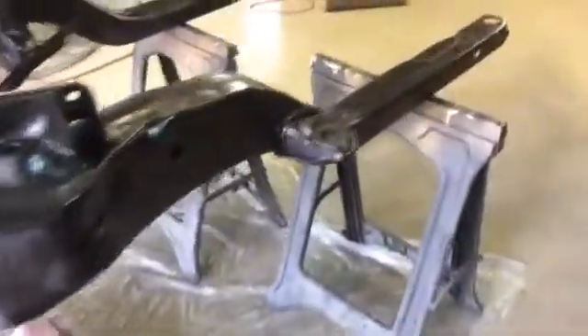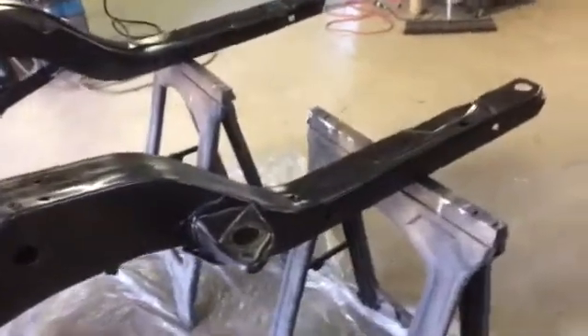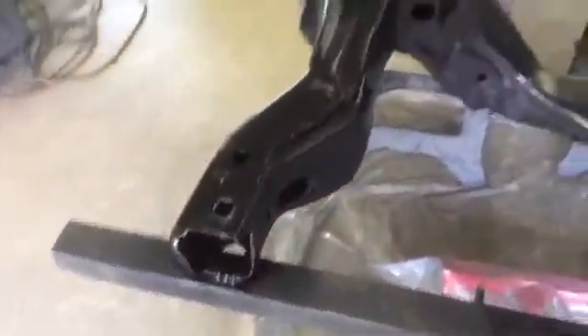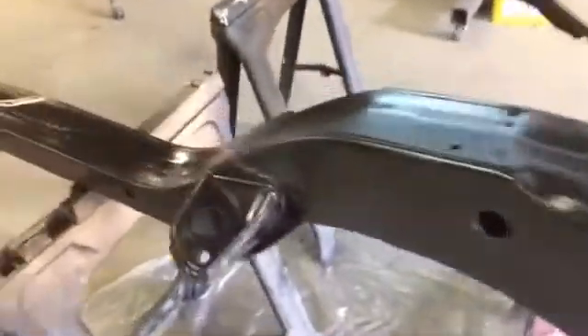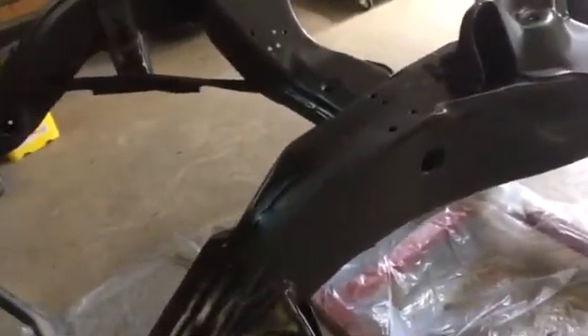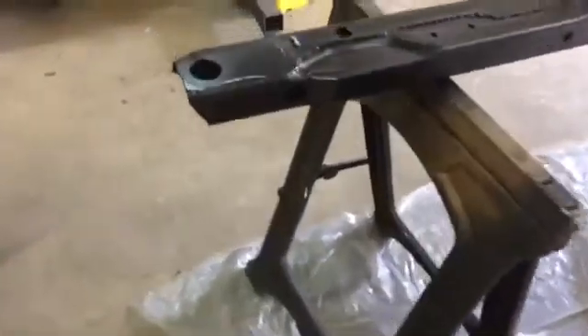It is Friday morning — actually about lunchtime now. We've been on this thing since about 8 o'clock. I know it's not perfect. There are some places that I missed that were kind of hard to see until I started shooting it. But it's going to be good for me. I'm pretty happy with the way it looks. That is two coats of epoxy primer, and then I'm going to come back over it with about two coats of good hard enamel paint — that same stuff I painted the A-arms with.